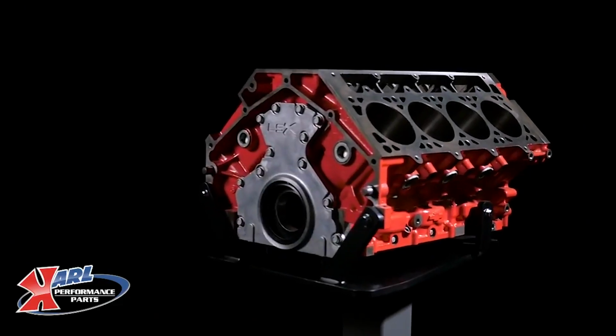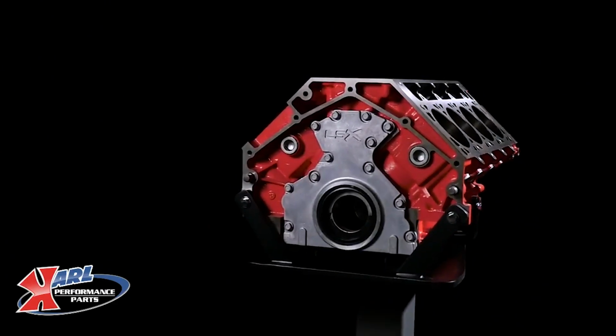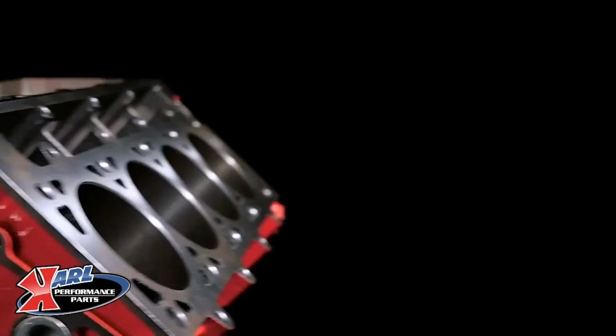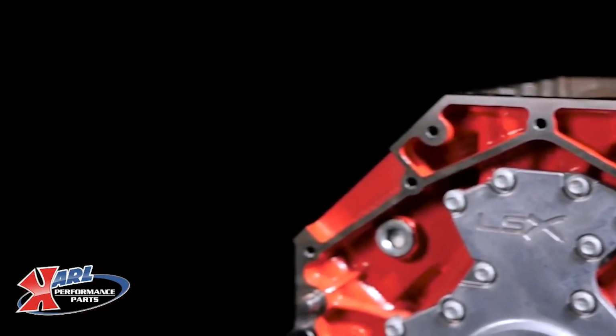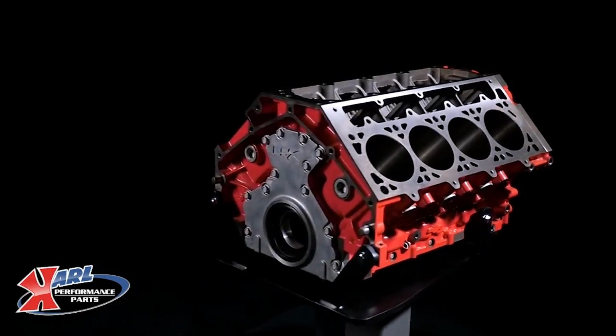Just an LSX 427, build ourselves out a 7 liter motor. Cool. I think it's probably going to cost a lot of money to buy a bare block and start from scratch, probably a similar amount of money to buying an LS7. I think your end result there is around the same as an LS7. We may be able to optimize in some very specific aspects, but you'd be within a few single digit percentage points of how much you could feel the difference.